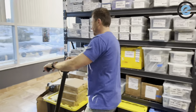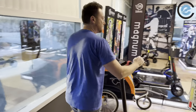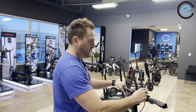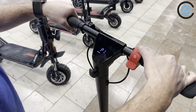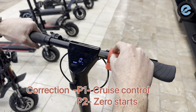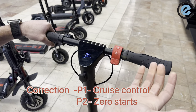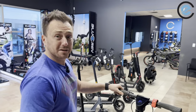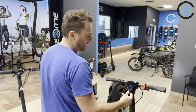That's cruise control. Now we're in the scooter section of our shop at Epic Cycles. To turn off cruise control, hold both buttons again to enter the settings, go to P1, press enter, and change it to zero — now there will be no cruise control. Some people find it a little dangerous if they don't realize the cruise control is active, especially at faster speeds.